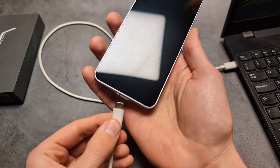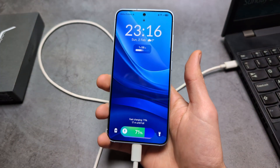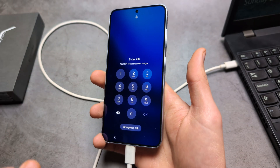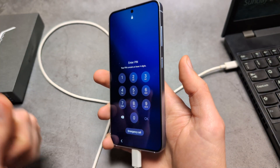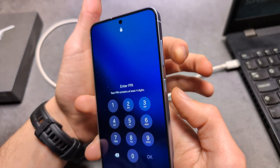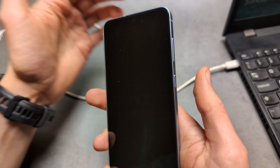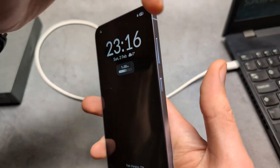What I'm going to do is simply first plug the cable into my phone — you can see it's actually starting to charge — and then I'm going to restart my phone. To do this, I'm going to hold the power button and the volume down button until it shuts down, and once it shuts down I'm going to jump to holding the power and the volume up.